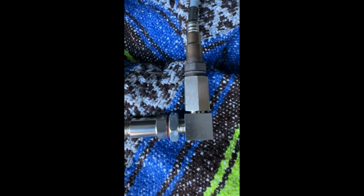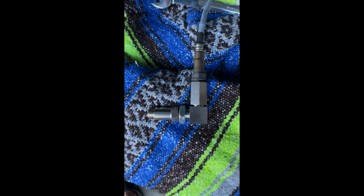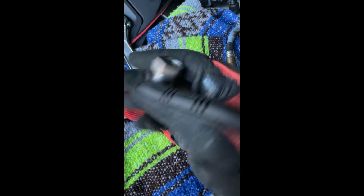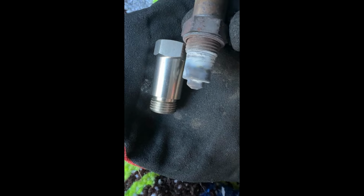So what I'm gonna do is remove this one right here and this one, and I'm just gonna connect it from here to the O2 sensor and see if that's enough. Ah, this is hot as shit. But basically, this is gonna go straight into the downpipe. You can see the hole is slightly smaller. Then the O2 sensor is gonna sit right there. So that should hopefully have enough restriction